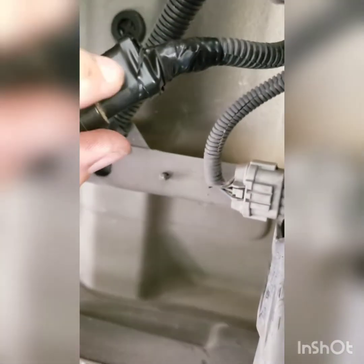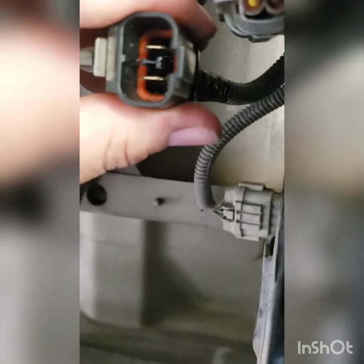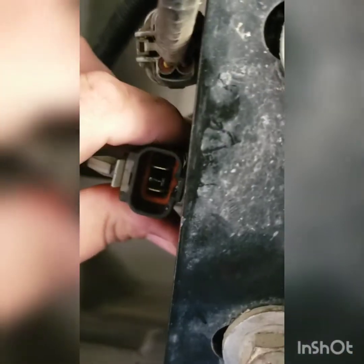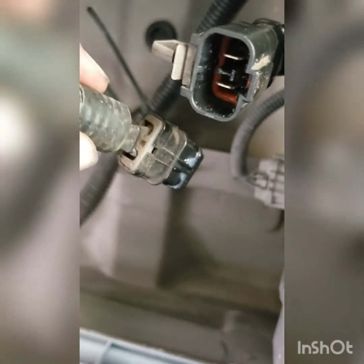Here's how it looks with it taped back up. I extended the tape onto the connector itself — that's not how it was originally, but you can see the two wires now. I'll include in the description a link to the video I found that talks about de-pinning this kind of connector, and I'll add as much detail to the title as possible so this video is easy to find if you want to make the correction on the truck harness side.